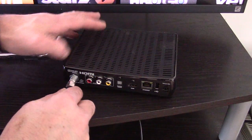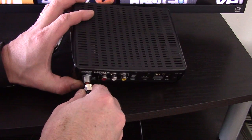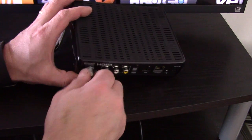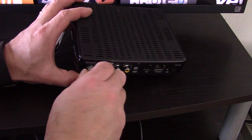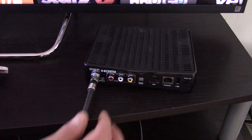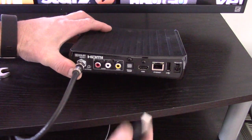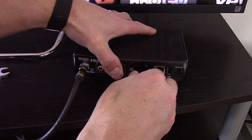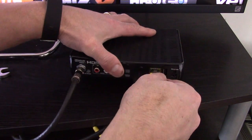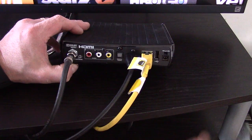I'm going to hook up the coaxial, which goes to the wall — we just completed adding the splitter down in the garage. Yours may be in your basement or wherever the cable pulls into your home from the dish. Keep in mind they don't recommend the Joeys being further than 200 feet from the hopper. I've got HDMI plugged into HDMI 1 on my TV, and Ethernet — my house is wired with Cat 5e; if you're building a house I'd probably go with Cat 6. And let's go ahead and do the power.